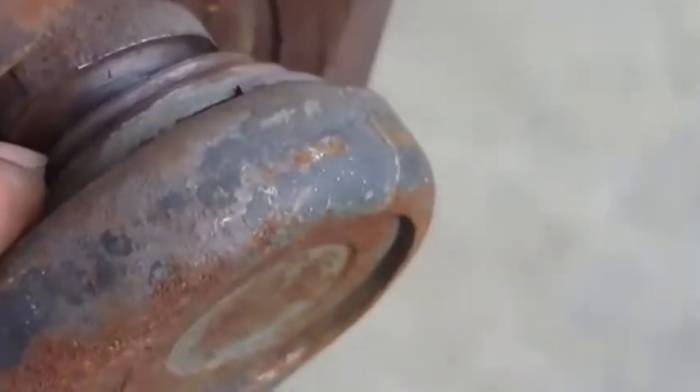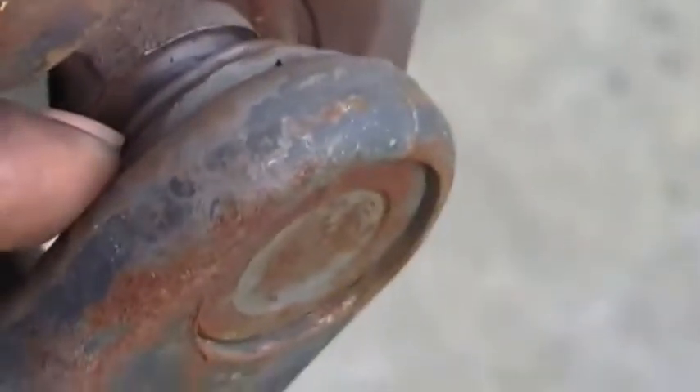It's going to be like a washing machine or a dryer — all unbalanced. But you can tell this right here has got to be replaced. I'll replace all four of the bearings. It's hard to turn — hard to twist. See right here, that's the problem. You can hear it, you can see it, you can feel it. The two left and right — the up and down movement — that's the problem. You can see the left side compared to the right side. The left side is totally messed up, so I've got to replace the left side.